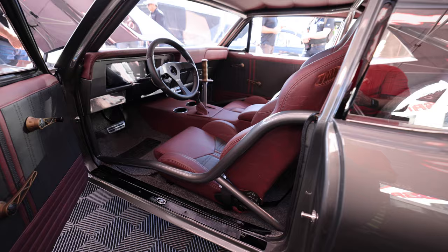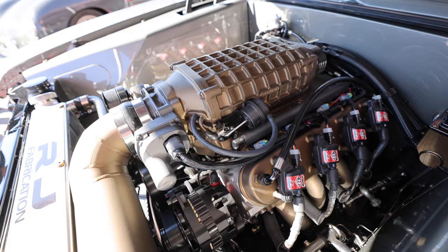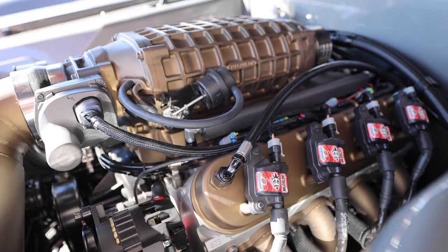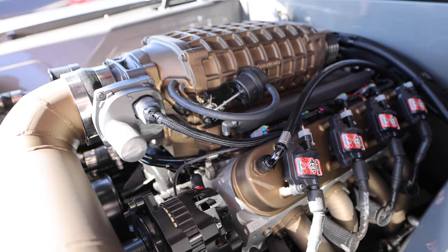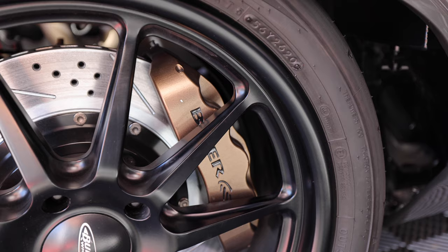The power plant already had a supercharged setup with a Magnuson supercharger, so we sent that off to Meruzzi and stroked the 376 to a 418, then put a Holley Dominator fuel management system in it with the same size Magnuson supercharger — just spinning it a little bit faster. We should have a thousand crankshaft horsepower, and hopefully we'll be in the mid 700s with rear wheel horsepower.